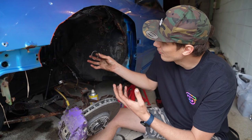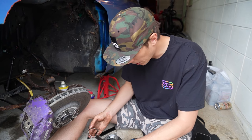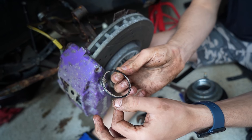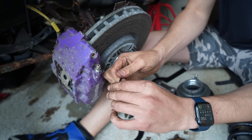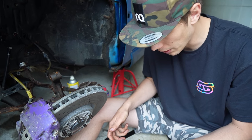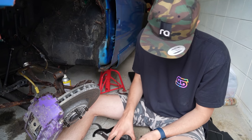This is a mess - we got the coilover, the bag, and everything out. It came apart really easily with a little WD-40. Here's why it's leaking: the O-ring is actually intact but there's this crusty stuff around it that's letting air past. The O-ring looks really nice - it looks new actually. I'm going to clean all that gunk out, re-lube it all up, and it'll probably seal and be fine. First time working on airbag stuff - this is really interesting.